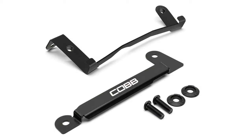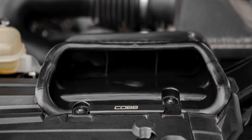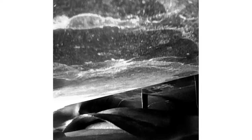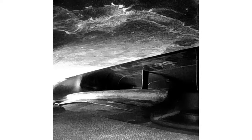This little bracket may not seem special, but our calibration and hard parts team discovered a major flaw in the design of the stock intake that this helps resolve. Under heavy acceleration, the materials are too soft and flexible, causing a drastic amount of collapse within the entrance of the scoop. That produces a huge reduction in airflow, which becomes even more prevalent when tuning for more power.